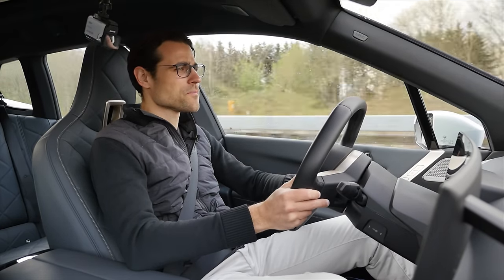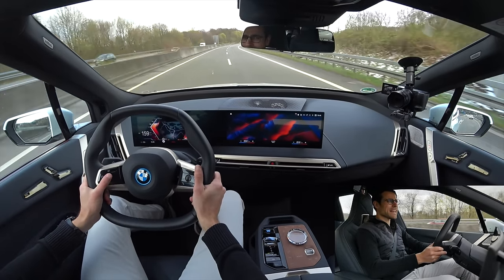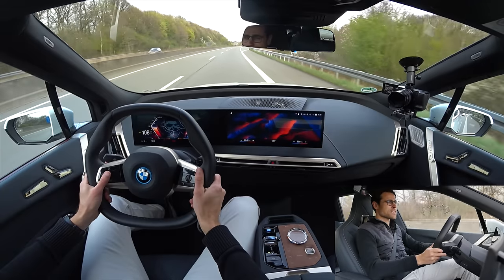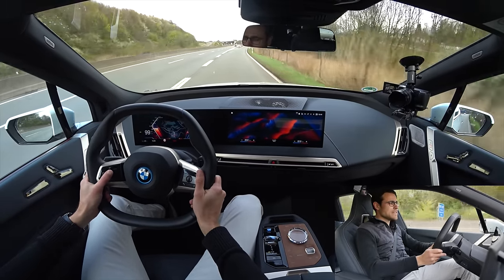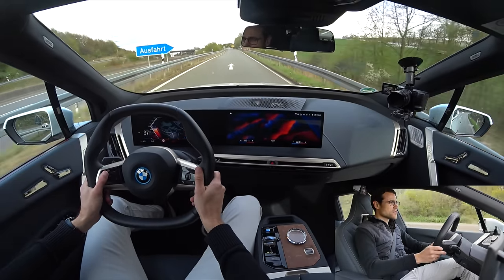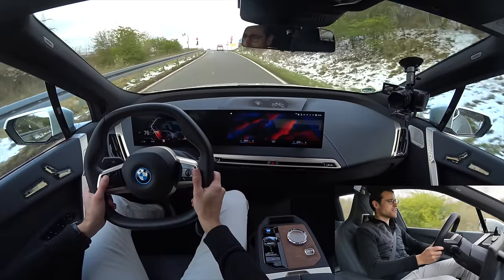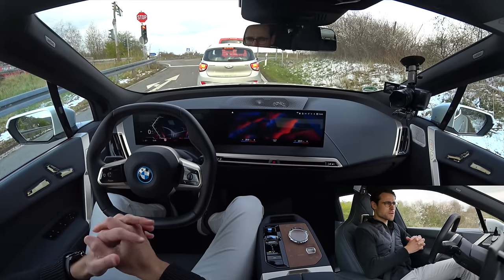And that's also enough speed for today. Just letting the car roll now. Massive rolling power, of course. On the brakes, sometimes there can be problems with EVs that the brake blending, so it's called, is not that good. So the transition between where the recuperation ends, or is at highest stage, and the real brakes are being applied. And here so far, a very smooth and controlled feeling indeed. Can't complain about that at all. It really feels very natural. So all the hardware effort they've put into this vehicle, you really feel that all that experience from decades of BMW vehicle building went into this vehicle, although it's basically an all new one and they don't have so much experience with these EVs.